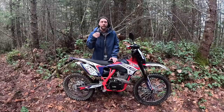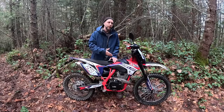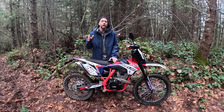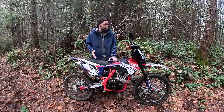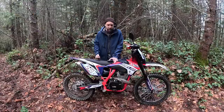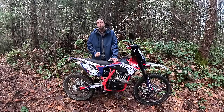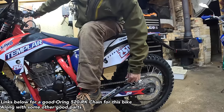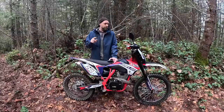Also go around the back edge of the taillight where the black meets the red lens and put a little clear silicone there, because I got moisture in the taillight on the other bike riding in wet conditions. Do that before you get going. Another thing: there's a crankcase-to-airbox vent tube — about 3/8" ID — that on my bike was sitting right against the exhaust header. If you ran it that way it would melt a hole and leave your crankcase open to dirt. I just zip-tied it over to another wiring loom to keep it away from the exhaust and shock. Also, plan to replace the battery and chain — they're pretty cheap quality on these bikes. And definitely check your chain tension out of the box, as mine was way too tight.